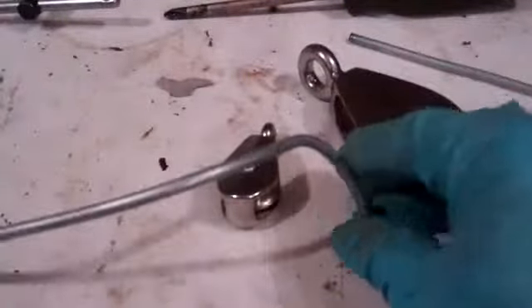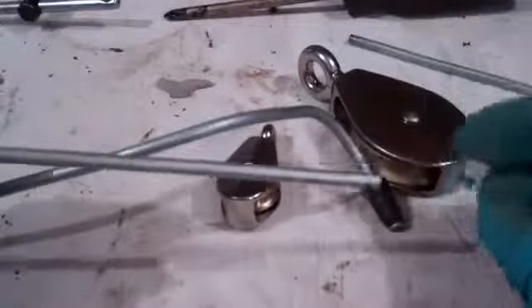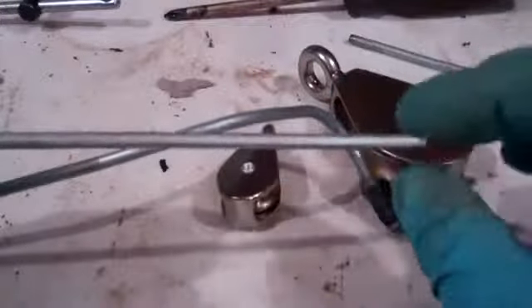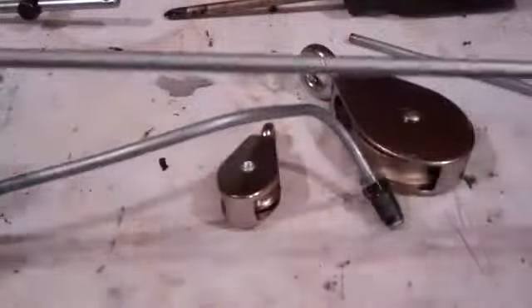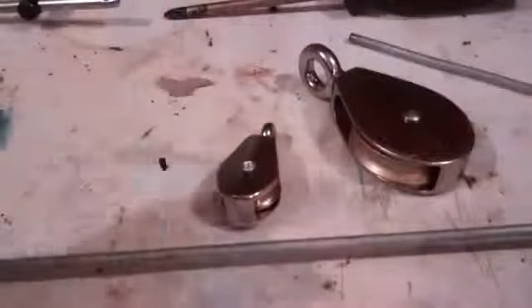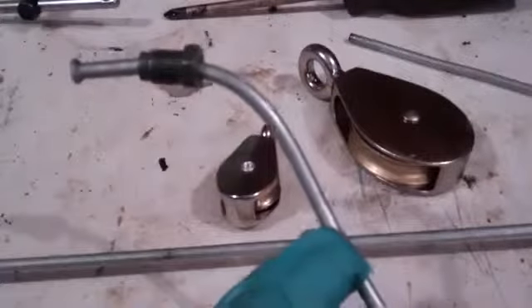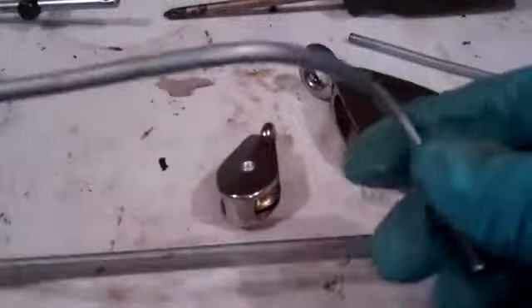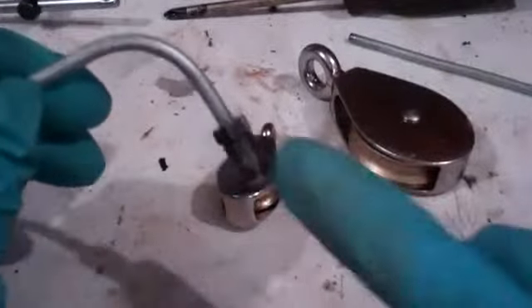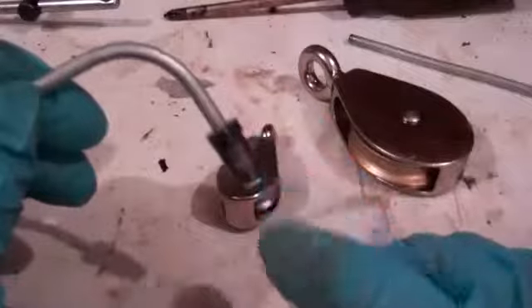Here's the shape I want - this one already fits. Here's the line I'm going to bend. I want to mention something important: you're going to put your fitting on and then do your bending, but you want that fitting to be in the right position before you bend certain points. For example, we have to put the fitting on the line before we bend it. We don't want the fitting down at the wrong end because we won't be able to push it back up to the flared end of the line. So I want a 90 degree here, and I can make this 90 degree and put my fitting on afterwards and flare.